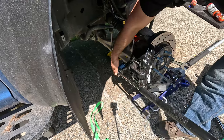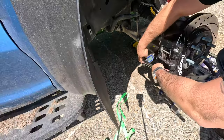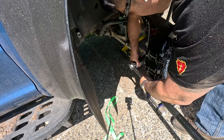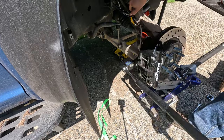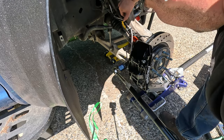For the lower shock mount nut, you need to get it to 406 foot-pounds. I ended up buying a 3/4-inch electronic torque adapter and 3/4-inch ratchet from Harbor Freight and used it with my jack bar to torque it to spec. The last time I did this, I only got it as tight as I could with a 24-inch breaker bar, but 406 foot-pounds is way more than I thought it would be and definitely more than I did last time.